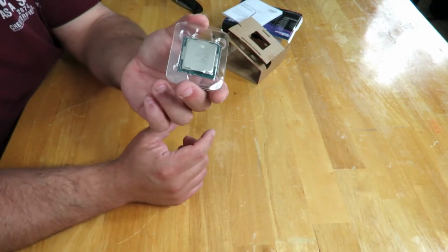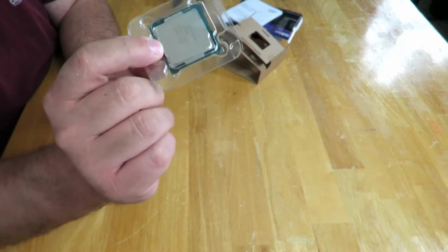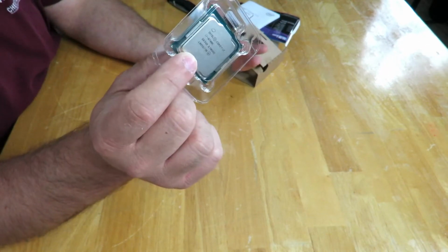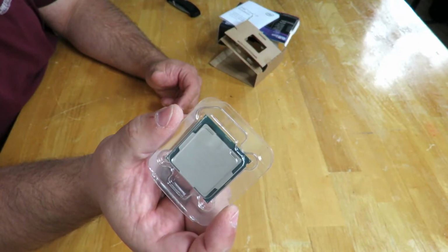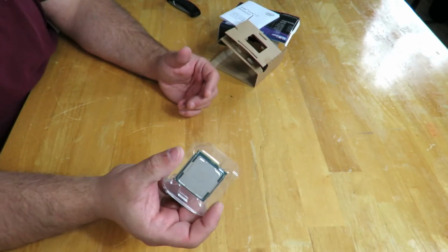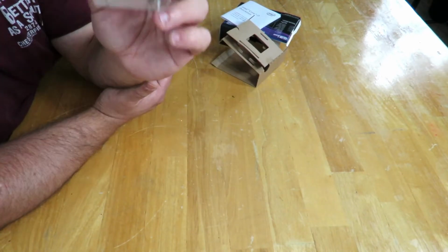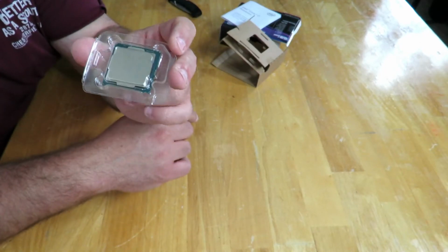Now, aside from being a processor which processes information, this also has an onboard GPU, the Intel HD Graphics 630. Mind you, if you don't have a video card, you know, you need something to get by on, you can use it, or maybe it might actually be good enough for you. Supports DX12 and OpenGL 4.4, Intel QuickSync video of course, then it supports virtualization as well. Hyper-threading, as I mentioned before, and Turbo Boost, again, as I mentioned before. And it will support the Intel Optane memory. And then I'll go ahead and list some more of the stuff in the description below.